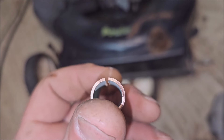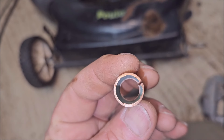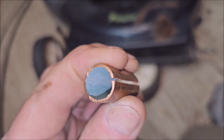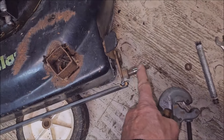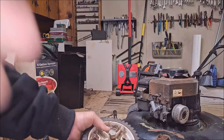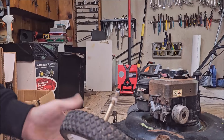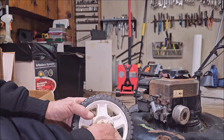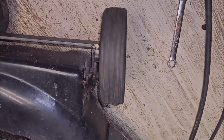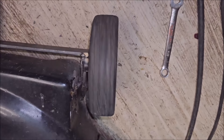Just in case this works, let me show you what I did. Took an old piece of half-inch copper pipe, cut a long slit in it. It measures - you know, it's a little bit too loose - so hopefully when we shove old dude inside that wheel it'll squeeze him up, tighten up around here, get rid of some of the slop, fit inside the wheel really good. Life will be good. Let's check it out. You know, that ain't bad for a redneck. I'll get another season out of this mower easy.